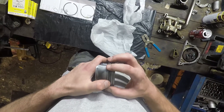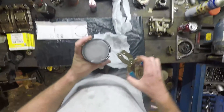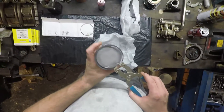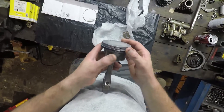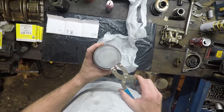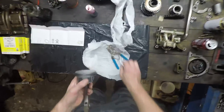I'm a bit worried about breaking ring lands and things like that, so I'm just trying to take my time and make sure I don't scuff the outside of the piston at all. I'll take my time to make sure the ring is in place and covering that spring properly. Being a novice at this, one of the things that surprised me is how wide open the rings sit and spring open when they're not inside a cylinder bore - there's quite a lot of force on these rings when they're in the bores. This is my first proper attempt at doing this process. Once they've been compressed and gone into the bore, they should sit in there nice and tightly, keep the ring gap as measured, not cause any blow-by and give me good compression.